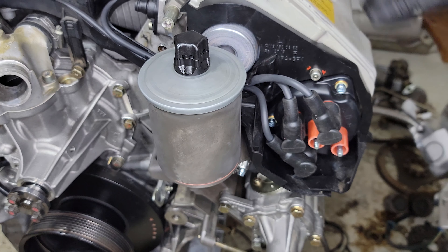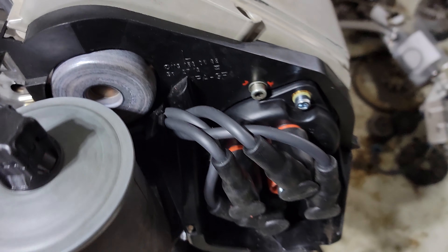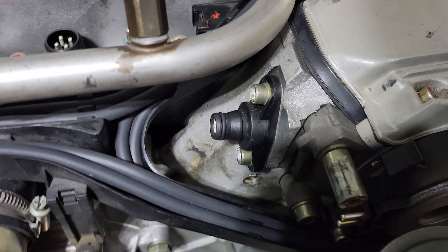When you're done, your wires should look something like this — nice and in the right channels. These might be a little snug but that's how they should fit. There are also coil wires that go in there. I think the coil wire goes right there and somewhere else — we'll get those on when we get the engine installed. The wires on this side were a bit long but when you use an aftermarket wire set you kind of tuck them in and make sure you don't kink the wires — just nice soft bends.